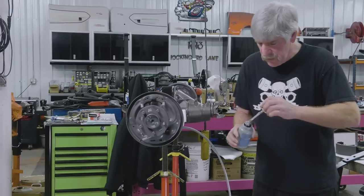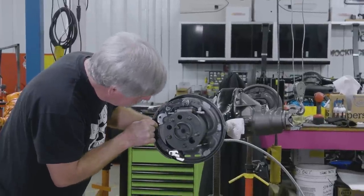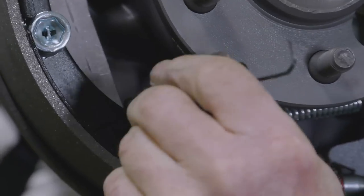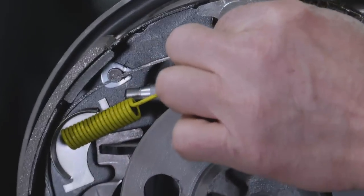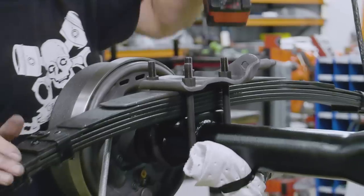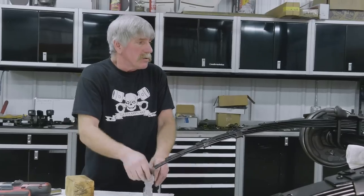I install the parking brake cables through the backing plates to the brake shoes. With the axles and backing plates on, I can put the wheel cylinders on. Then I install the secondary brake shoe on the back — this is where I attach the parking brake cable. Then the primary brake shoe. Being a 1969 model, it has self-adjusting rear brakes, and the adjustment is critical for it to work correctly. The last thing I put on are the new rear brake drums. Then put the leaf springs on, secured with two U-bolts on each side and four U-bolt nuts on each side. Front leaf spring hangers go on next, and on the rear we put on the shackles. Basically it's all ready to go in the car.